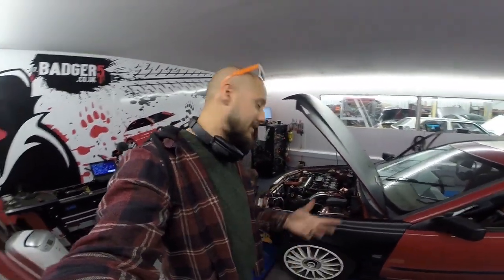We've done a couple of quick runs just setting up the dyno. It's running very rich at the moment, so I've leaned it out a tad. We think the ignition is very safe, which is what we thought anyway because we've mapped it on the road. We've not had a decat or anything like that, so we kept it quite safe.